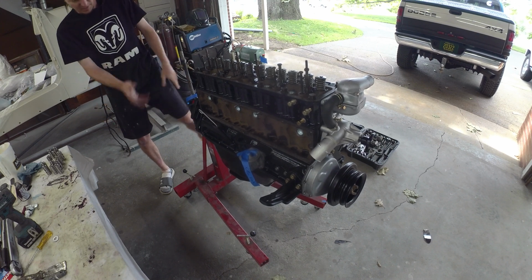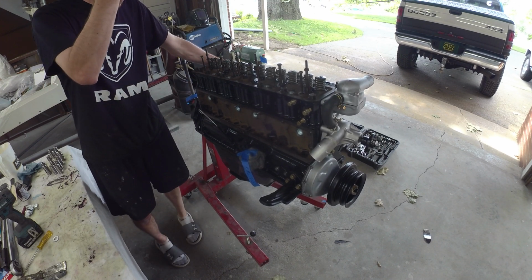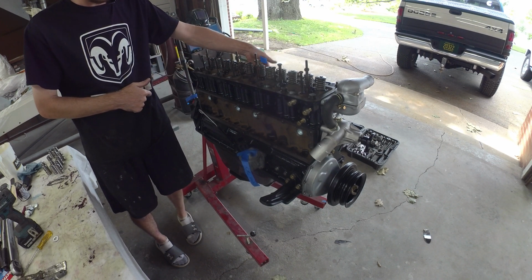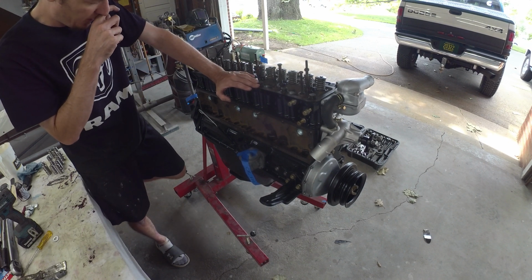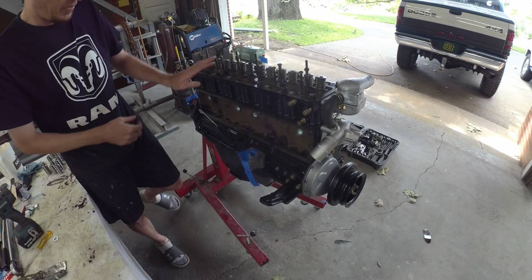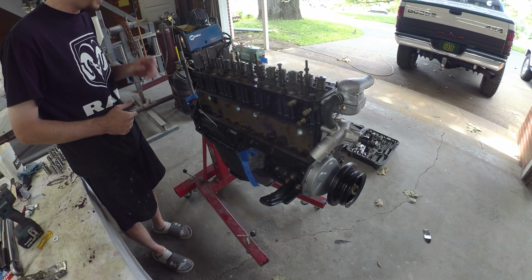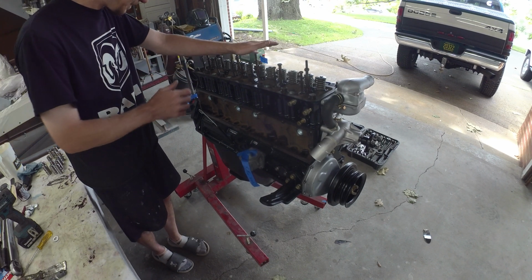And then past that, I'm going to leave the intake manifolds off until it's in the frame. I don't want to jiggle them around too much with those gaskets. They're finicky enough already with the big inline 6. They're notorious for exhaust and intake leaks. So the longer I can leave those off, there's no body on the frame, it's easy enough to get in there and do those. And there's no real need to be able to rotate. So I'm good with that.